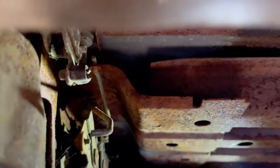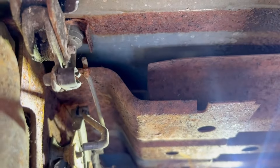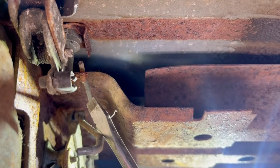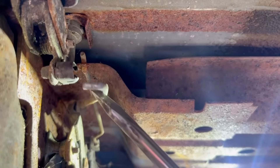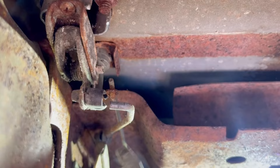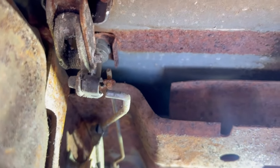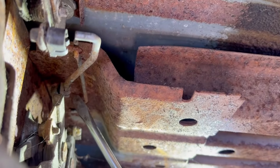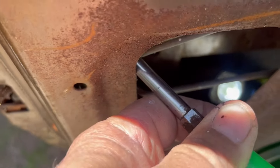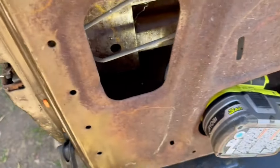There's another clip right here - another rod with a clip. Same kind of deal happening down here. Same thing, just take the screwdriver and get behind the rod and push on it. Had to really put some leverage on it, had to kind of press against the side of the door inside. But both of those rods are now out. Now let's get the rusty nuts - let me get some lubricant spray on them.